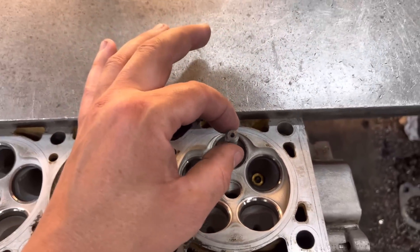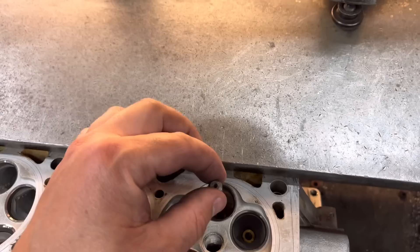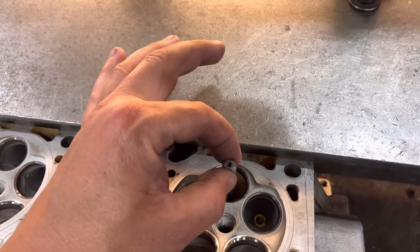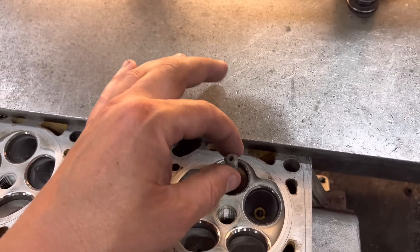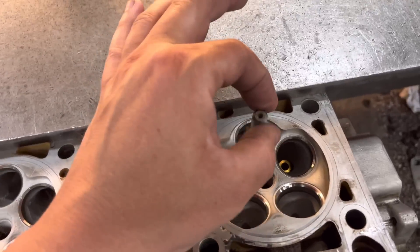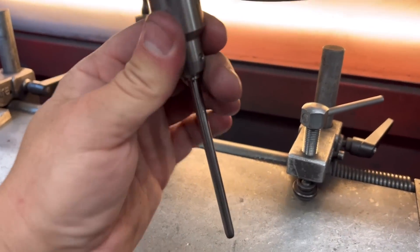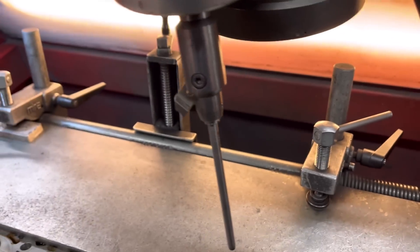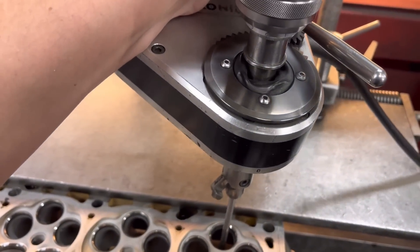You need a very, very slight bit of play, because the way this CNC works is it goes forwards and backwards in the X and Y, and finds the centre of the hole. So that is absolutely perfect. Then what we do is we clamp it up there with a little grub screw, and we just put it down the first hole.